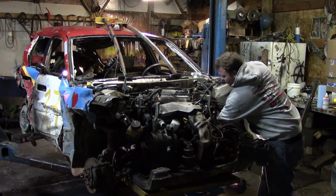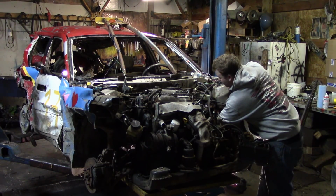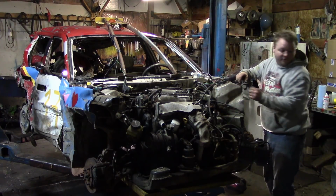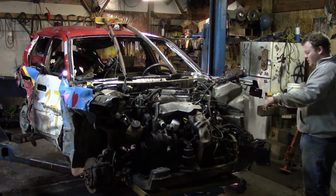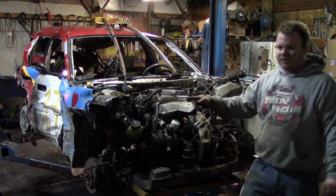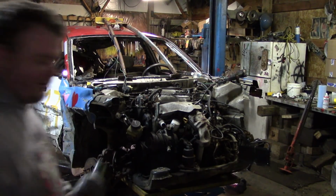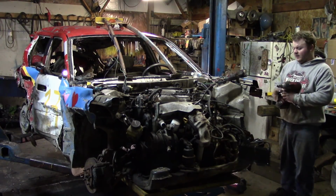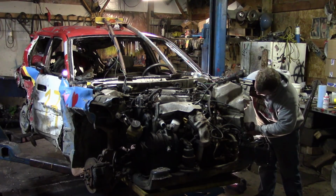We're just getting the 12mm bolt out for the steering rack right now. But the struts are giving us quite a hard time. I think they've been on there for a long, long time. So I don't know if I can remove those because they are giving me such an issue. I'm going to try this side, but my gun won't undo this side. So that's pretty tight if my gun will not undo. This thing's good for 375 foot-pounds. So they're really on there. If I get one side, that's going to be good enough to get this thing out. And then I can do it on the ground, I guess.